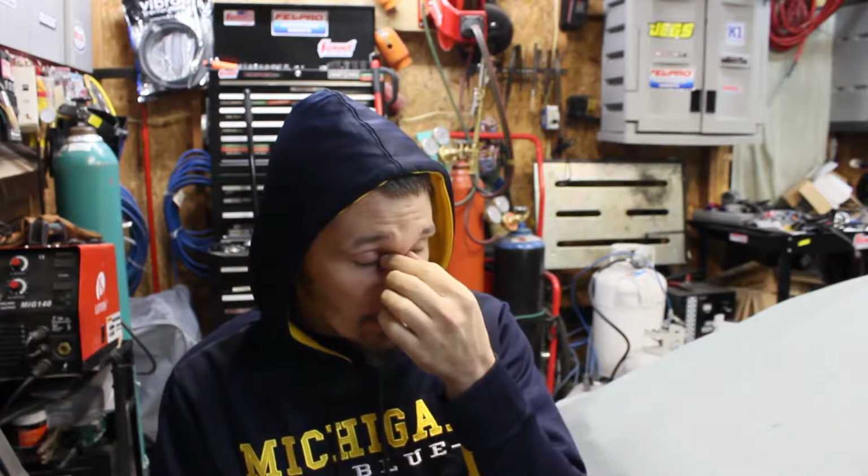So the 4L80E is basically the same transmission but with overdrive. It was a later model, they put overdrive in it and called it the 4L80. The direct drum's basically the same, so I picked up a direct drum out of a 4L80. It came with a 34 element sprag. I bought a new sprag because it was a used drum, so I installed that on there.